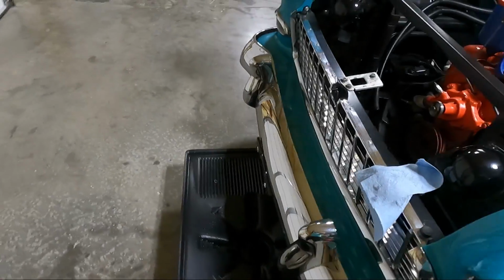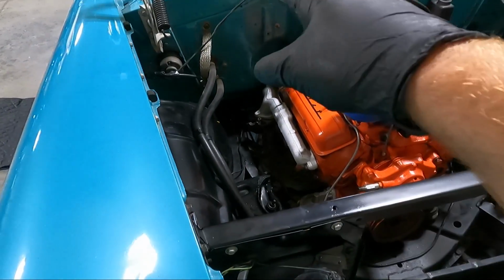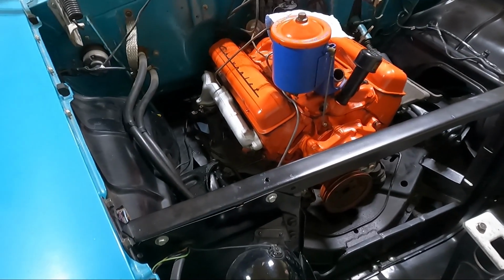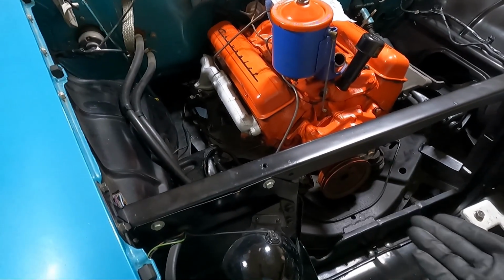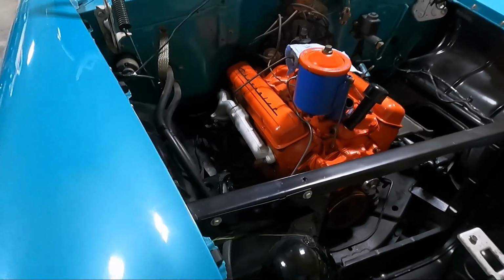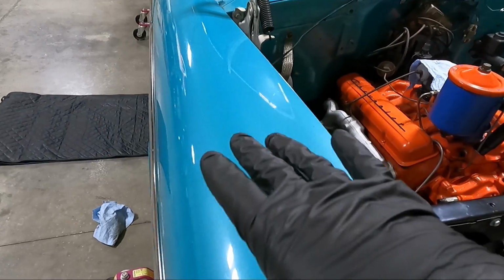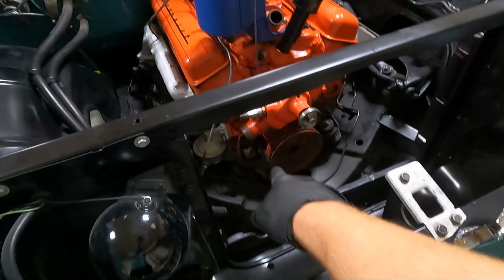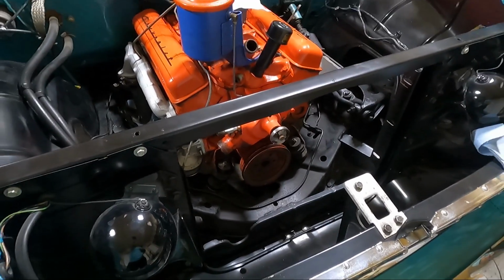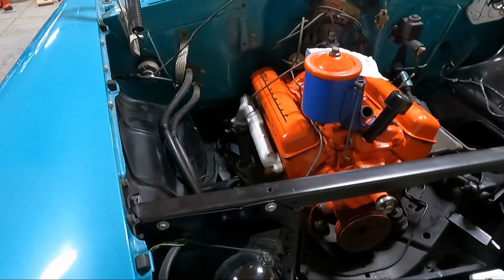I'm getting ready to work on the other side, but one thing I did want to tell you is after I got those transmission lines loose from the back of the transmission, I went ahead and routed those out, and they're sitting outside draining. So yeah, I think that'll make our life a little easier, so we're not having to try to clear those as well. But guys, we're getting very, very close to hooking a cherry picker up to this thing. After we get the transmission bolt or mount off on this side, the only 2 we've got holding it are those 2 engine mounts, and they're very easy to access. So let's get this other one out and see if we can get the cherry picker over here and figure out a place to hook up.